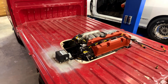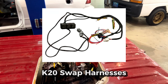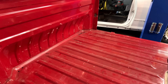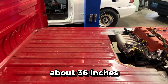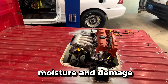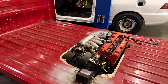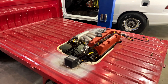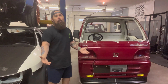You've got to make that turn extremely quickly if you want to clear, especially with the motor torquing. Something else to keep in mind is that the K20 swap harnesses — the plug-and-play ones you can purchase just about anywhere — they're drastically shorter than you need them to be. It stops right here in the bed, so I've measured it out to about 36 inches that you have to add to these harnesses to get them in the truck and keep the ECU safe from moisture and damage. You could get a very expensive custom harness made, but I have plenty of extra wires so I'll be extending it myself. These are just some things to consider before K-swapping your truck.